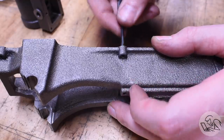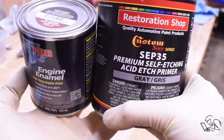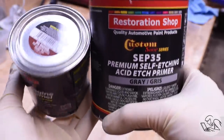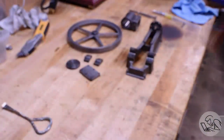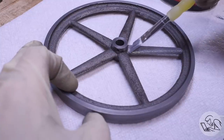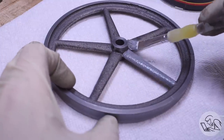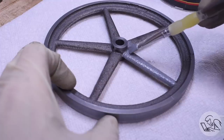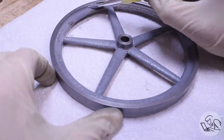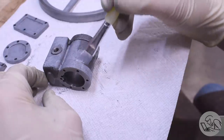I'm going to paint the engine next, and to do that I'm going to use this stuff. I've got an etching primer there for the cast iron and I've got a burgundy engine block paint. The reason I'm using that is because you need high temperature paint for this — obviously the cylinder gets very, very hot. In North America, the only two kinds of high temperature paint you can buy are engine block paint for hot rods or barbecue paint, and the latter only comes in black. The engine block paint only comes in about five colors, but luckily one of them was this burgundy that I think is going to look really nice. So I started by painting the etch primer on all of the cast iron areas.